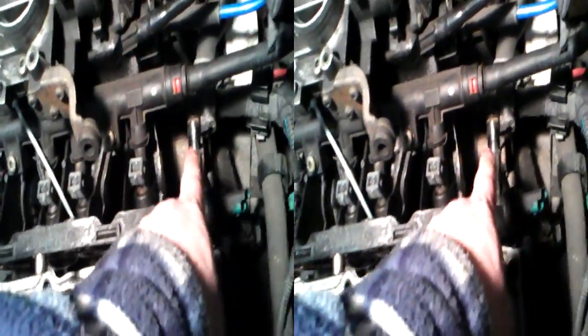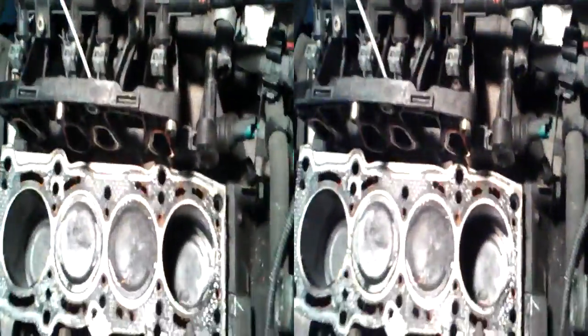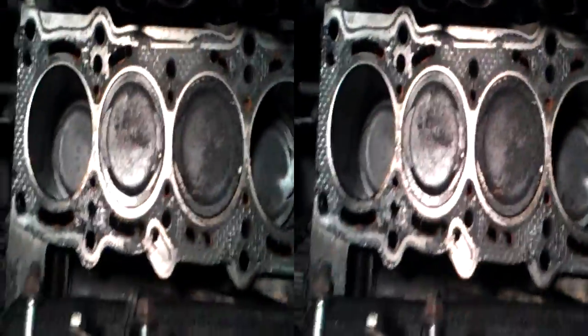I didn't have to take that off because I've removed the pipe, so it could have come off with the head. But I had to take it off because I didn't know for sure if there was anything in there. Now I can see there isn't. On the inlet ports — I've still got the cylinder head gasket attached on this side, so I'll remove that. It doesn't look like it's blowing; we're not getting anything blowing into the cylinders, so the sealing looks okay.